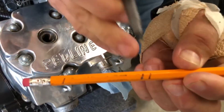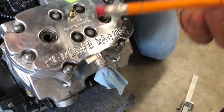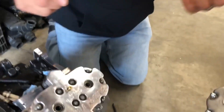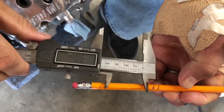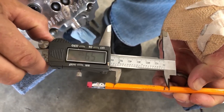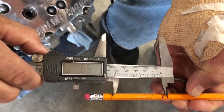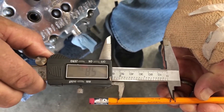See the difference? This was our old mark and that's our new mark. Let's measure this difference — it should be 58 millimeters. Here's my calipers: bottom dead center to top dead center. It says 59, but it's 58 — close enough, because I can't get the pen exactly in there.